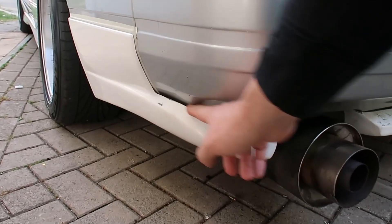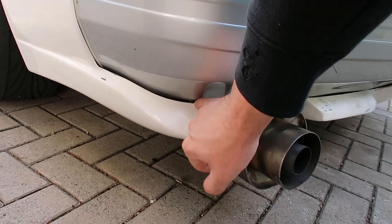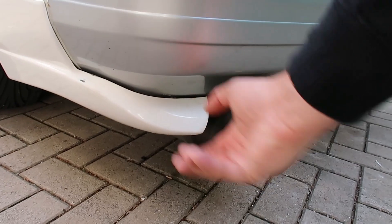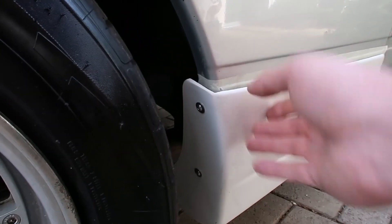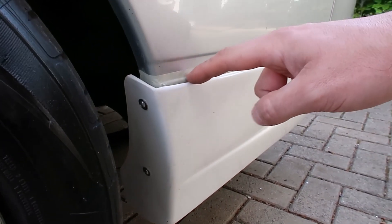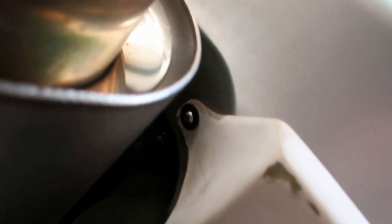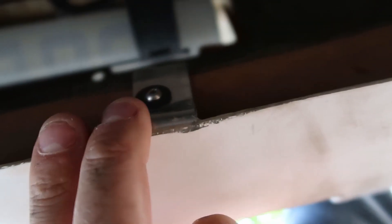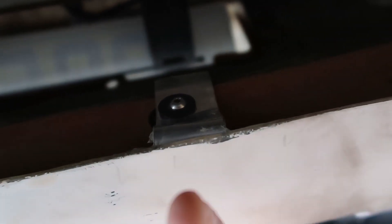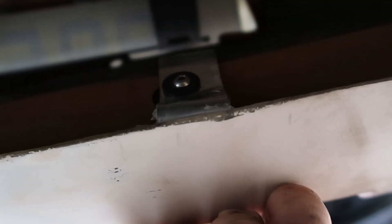We've got the back panels fitted up on the side here. There's a bit of a gap but I think I can work that out with the mounting points — these are just like a metal tab that comes down, we can bend that back in and mount it up a bit higher. On the end here I've used nut certs and an M4 bolt with a washer just to push through there, so that holds it quite nicely in place. I'll put a bit of 3M double-sided sticky in here just to hold that all in place once this is painted. For the center section we've got a couple of supporting bits on each side — the one up by the exhaust. You can see underneath here we've got these tabs that go up and hold to the original bumper mountings, which is quite handy. Instead of using the screws that came with the original bumper mountings, I've used M4s with nuts to go in there to give a bit more room and be more forgiving — I've got a bit of adjustment so I can elongate the hole and push it upwards if I need to to make it fit better.